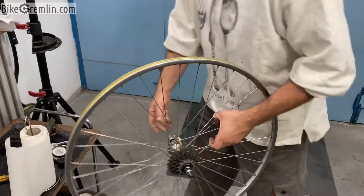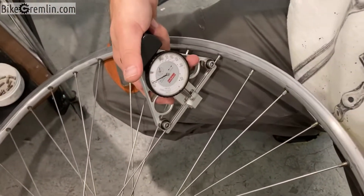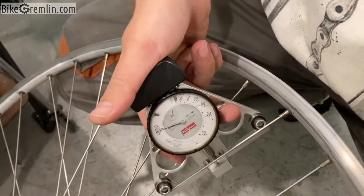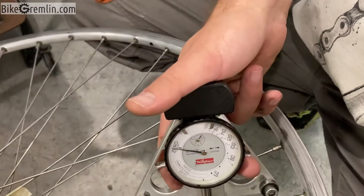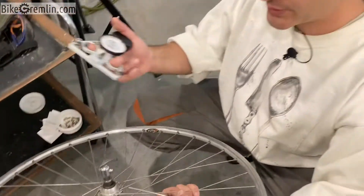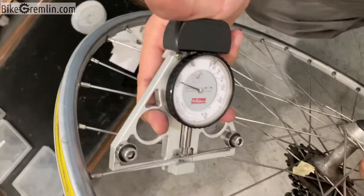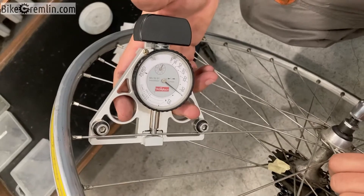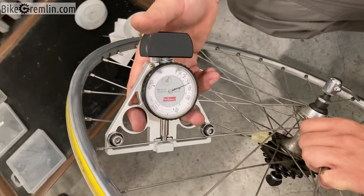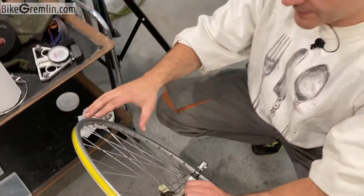Before I start tightening, let's check the tension of these spokes. This one says about 140 kg force, this one 100, this one 110, this one is a bit loose at about 80. I won't measure the entire rim — this is a rear wheel so the left-hand side spokes are a bit less tight, under 80 kg force, around 70 kg force tension. One is a bit tighter than the others, so it's not a perfectly built wheel but not too bad. It was important for this experiment that all spokes not be loose, so they can hold the rim in place.